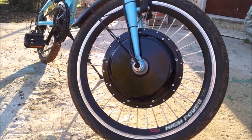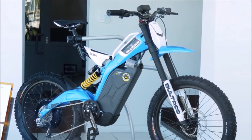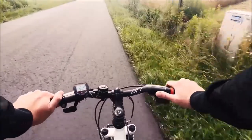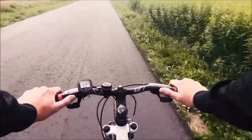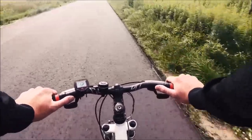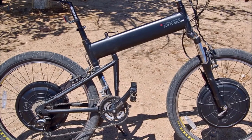Power Assist Motors: also known as pedal assist bikes, these are the bicycle equivalents of hybrid cars. They're designed to be pedaled quite a lot of the time and electrically powered either when you're tired or when you feel like a bit of electric help — when you're going uphill, for example. Unlike full power bikes, they don't have hub motors. Instead, there's a separate electric motor mounted near the rear wheel, driving it either through the gear sprocket or simply by pressing against the rear tire. Where a hub motor is difficult or impossible to pedal without any power — because you're effectively turning it into a generator — power assist motors turn easily with little or no resistance when you pedal. That gives power assist bikes much greater range than hub motor ones, as much as 80 to 145 kilometers or 50 to 90 miles.